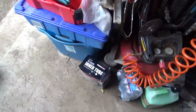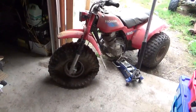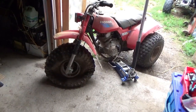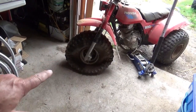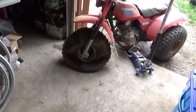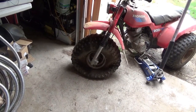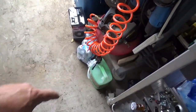Anyway, about fixing the tire - there are two ways to do it. We've got the old tube way; tubes are about 10-12 bucks for this thing, no big deal. Or we have the slime way. I'll be a hundred percent honest - I've slimed tires and not had them come back. But then I was watching one of Andrew's videos where he was working on a tractor tire, slimed it, tilted the entire tractor side to side to get the slime to really coat the inside. That container is about 25 bucks.